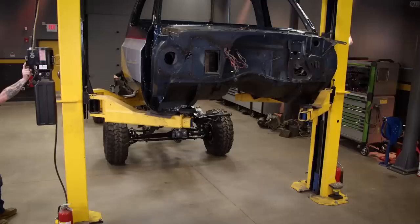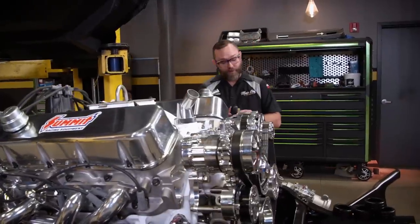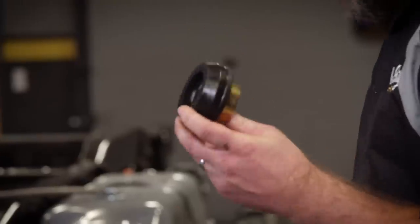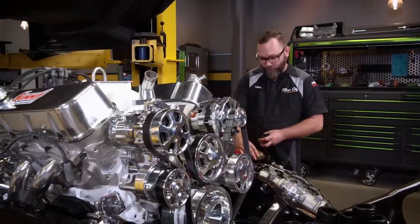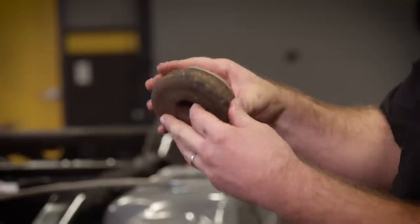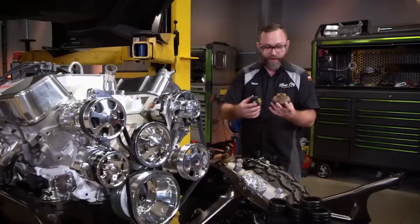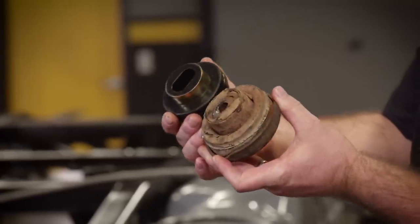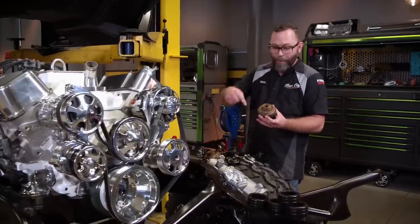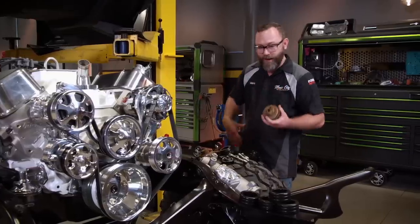The anticipation is killing me. Now it's time to get our body mounts ready. We went ahead and upgraded to these polyurethane mounts — it's a really nice kit, but it doesn't come with all of the hardware. You've got to reuse the sleeve and the washer, so it just replaces the rubber bushing. This is an original one — you can really see the difference, how nasty they were. In order to do that, I've got to press out the sleeve from this rubber. That's the hard part. Just got a pair of channel locks here on the rubber part, and I'm going to hit it with the air hammer.